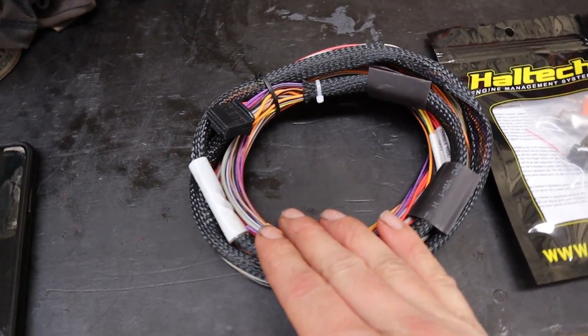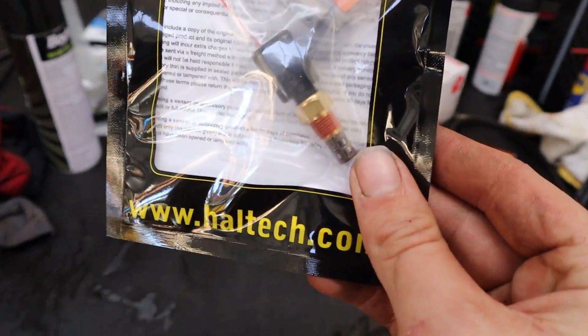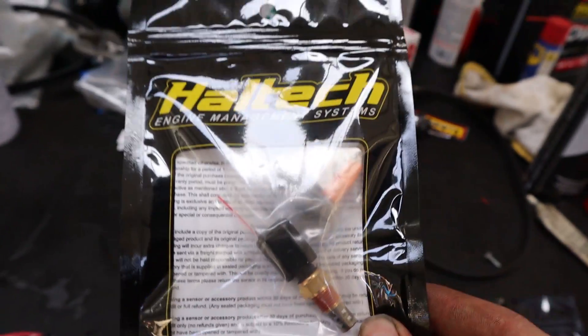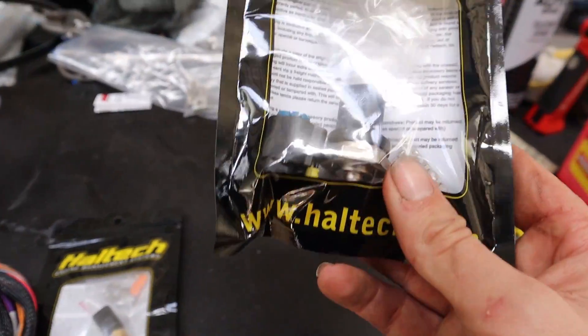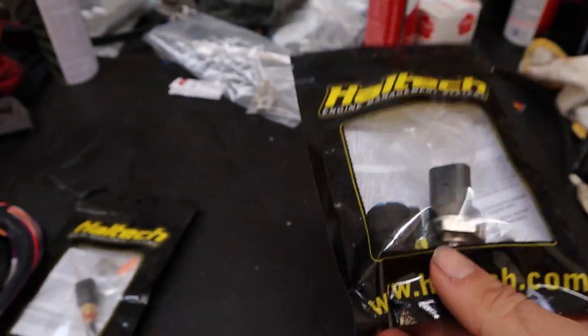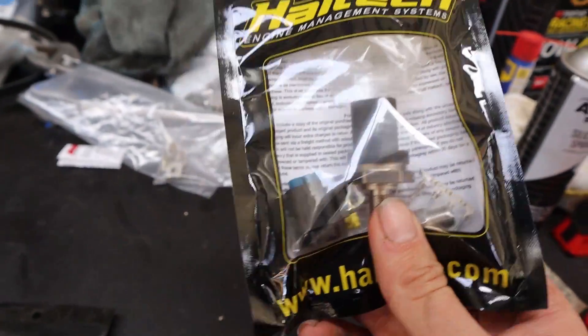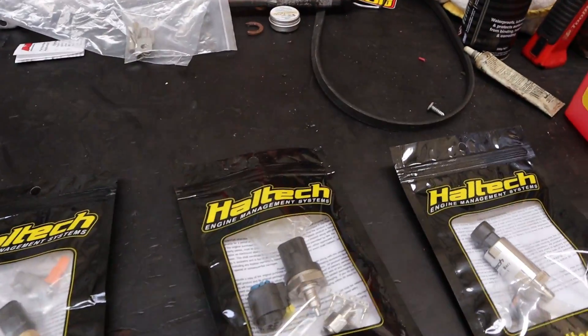So we've got our loom here. This is our intake air temp sensor — a pretty simple little sensor, one-eighth MPT. As you would have seen in the last video, I actually welded in a bung right in front of the throttle body, so it's got high-speed air temperature with a really nice accurate reading. And this here is a very cool little sensor made by Bosch. This is oil temperature and oil pressure in the same sensor — it incorporates temperature and pressure in one, which is really handy. My plan is to put this in the stock location on the RB20 and RB30, right behind where you would normally have the oil filter housing.